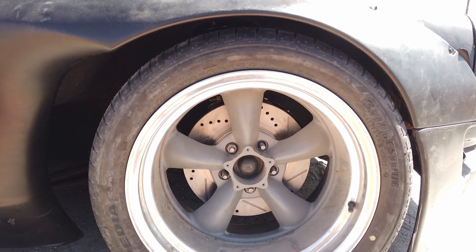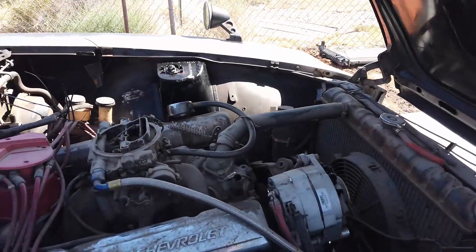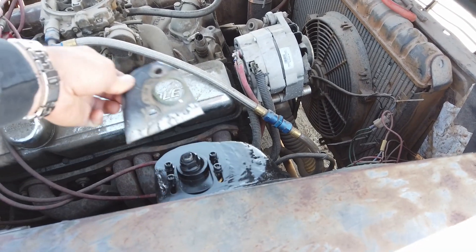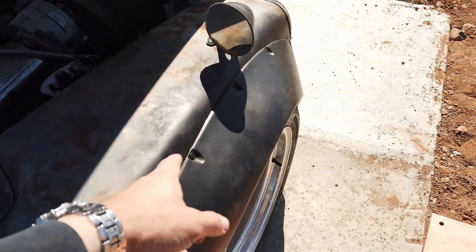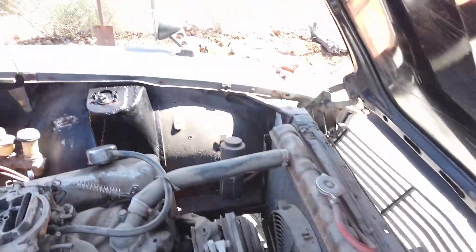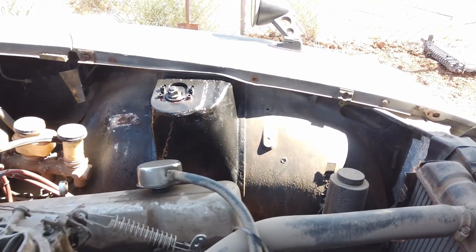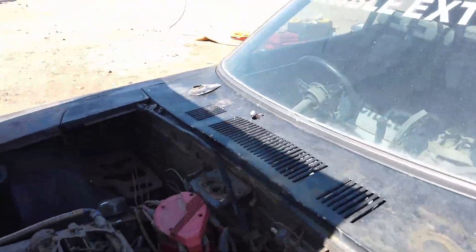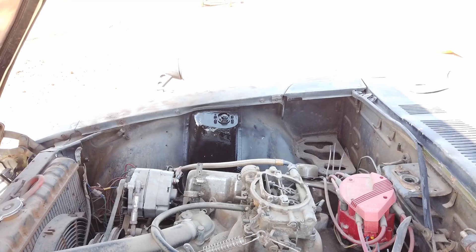Those are pretty decently performing cars. Here's what I did to get that: I cut out the original non-adjustable deal and spliced in the Neon camber plate, so I have fine adjustment for camber there and at the hub as well. The shock tower is still there and still spot welded — it just no longer tapers on the rear portion. I picked a target for caster, put it there, and still have tons of camber adjustment.